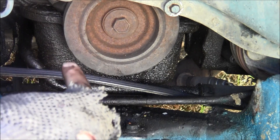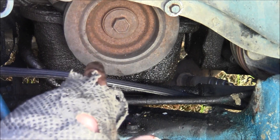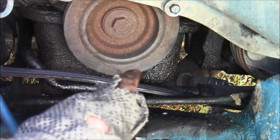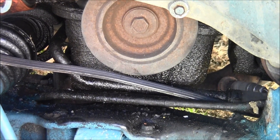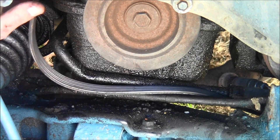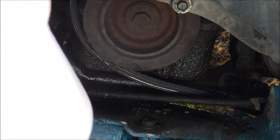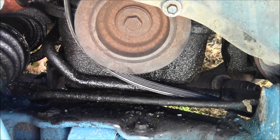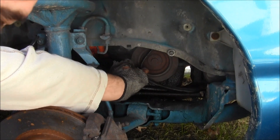The last part you want to be loose at is the crankshaft because it's easy to access right here. When I go to put it clockwise to loosen the tensioner, it'll detension it and I'll be able to slip it on there, then let go and it'll tension back up. Easier said than done because it barely fits. I need to get it to go up and around the water pump and down around the tensioner.